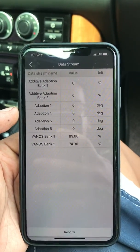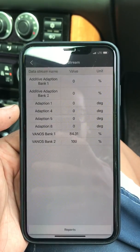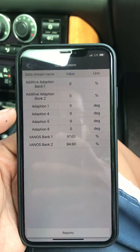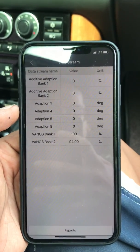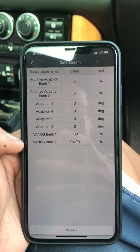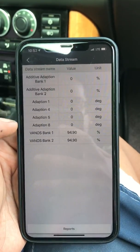It just got really smooth — you don't hear the rough idle. You can see the VANOS actuators working. It has almost certainly not thrown a fault code yet, which is why the VANOS is still activating. You see no adaption values reading either.